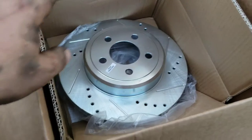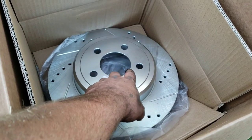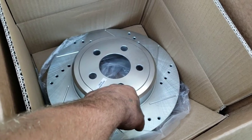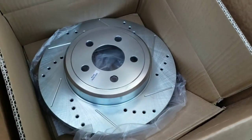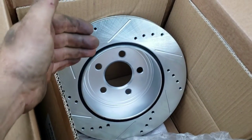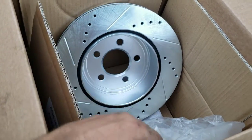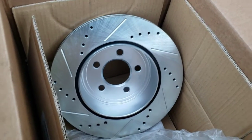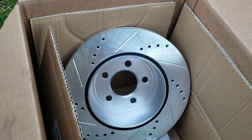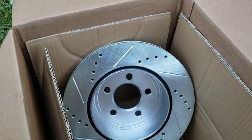I get these from a company called Brake Motive on eBay — not affiliated, not sponsored, but people always ask. These are zinc-plated so they don't rust. If you get generic rotors at the auto parts store that aren't zinc-plated drilled-and-slotted, they typically have a grease coating on them for storage to prevent rust. If they've got that gunk on them, get a big can of brake parts cleaner and a rag and clean all that off before installing.